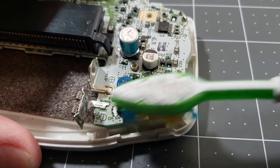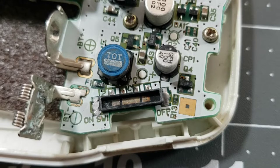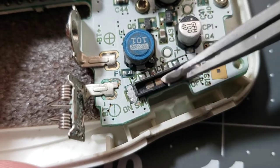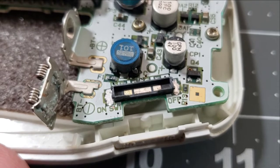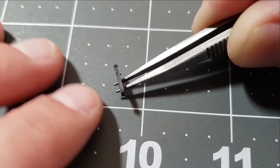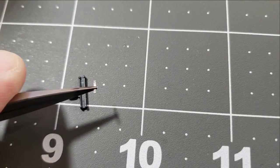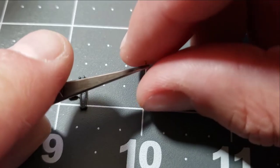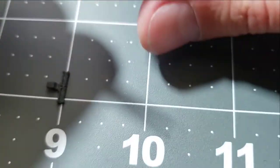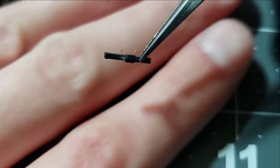Inside that switch doesn't look too bad. We're also cleaning that out as we clean the solder area with alcohol. Inside the switch is looking pretty good now, but I think we can polish it up a little more. I have here a trimmed mechanical pencil eraser, and I'm going to use that to try and polish up these contacts. After doing that and cleaning with alcohol, I think it looks pretty clean. The two metal contactors are kind of green and dirty too. I learned the hard way this tiny little metal piece can actually come out of the switch. Before putting it back, I want to get my tweezers and pinch this in the center and make sure those pins get bent up. They look like they have a decent bend in them now. With the switch clean and the contacts bent in place, I think we can start putting things back together.